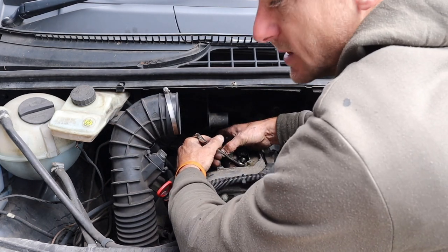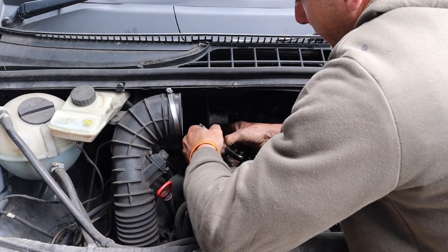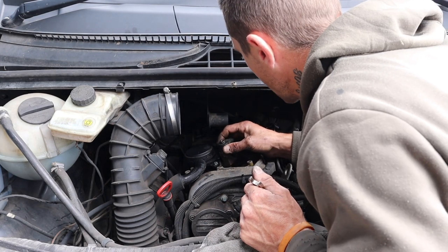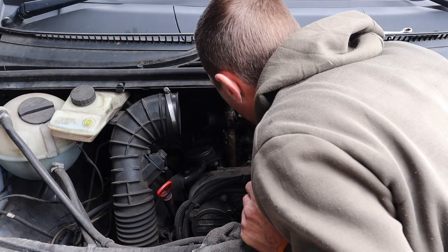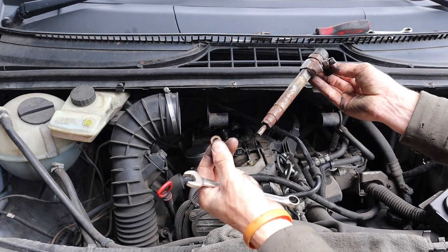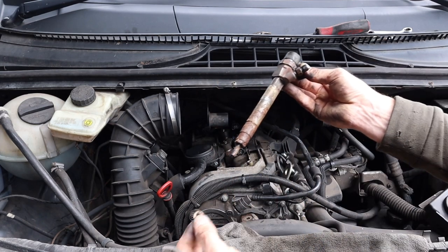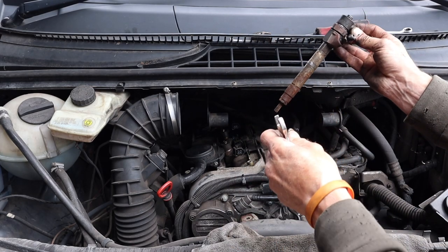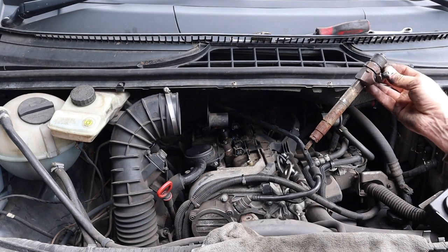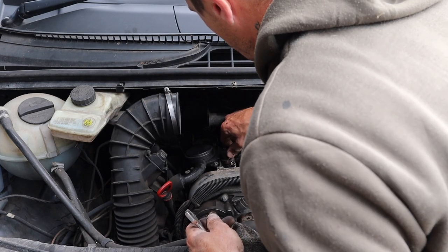If it's been blowing a while it can be a lot harder. I picked the cleanest injector to show you how it's done. I'm lifting whilst going backwards and forwards. There's the clamp. Injector number one is out and I'm lucky that the copper washer is still on the bottom — sometimes they stay in the head. I'm going to put this back in just for now until I get all four loose, then pull them out individually and do them one by one so I don't get confused as to which injector went in which hole.